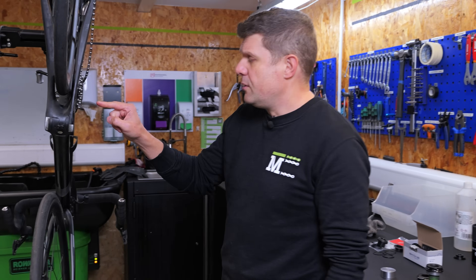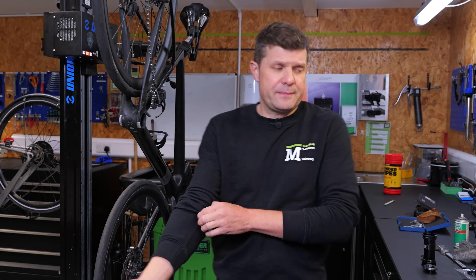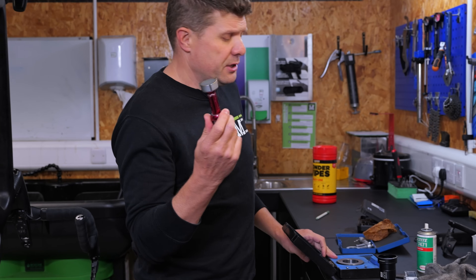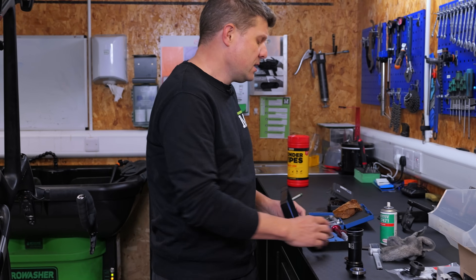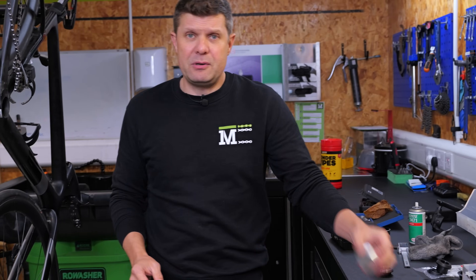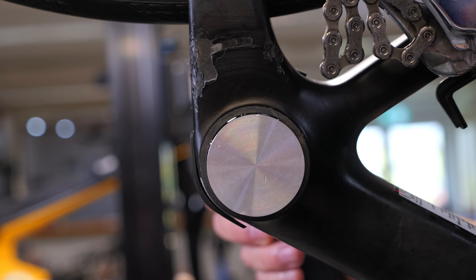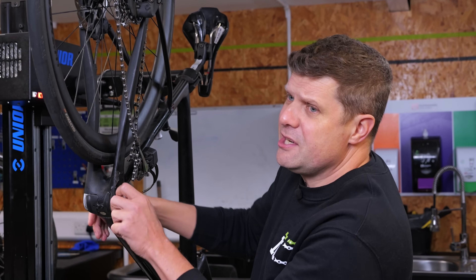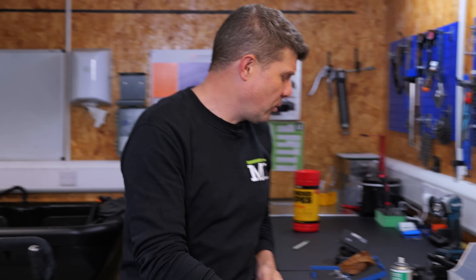So what is going on on this side, and is it even possible to fix? Your ball micrometer is really not going to be much use here because I don't think we've got anything remotely like a round hole. I can pretty much see that because when we put this in, I can see just gaps — quite a tight fit across here, but you could just see it's ovalized. It really doesn't take a genius to figure out that we've definitely not got a round hole, but how bad is the problem?